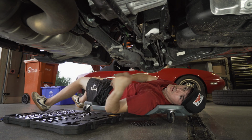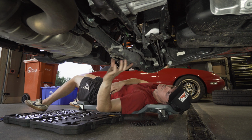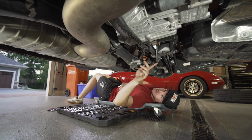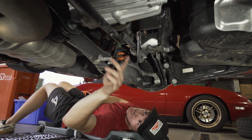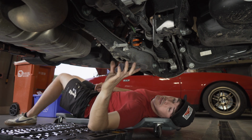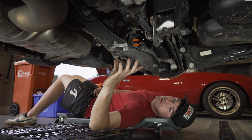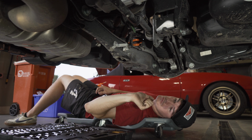We're just taking a quick look under the car. Stock bar, stock end links are inside of where the spring mounts on the rear arm. We're just looking at what tools we're gonna need. So the front of the bushing mount here, or what's holding the bushings for the Swaybar, is a triple square 10mm. And then the end links have a bolt and then the nut that are the same size over here, and they're 13mm. So we're gonna have a 13mm wrench on one side and then our 13mm ratchet on the other.